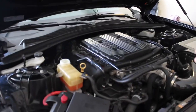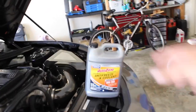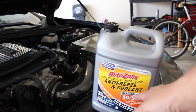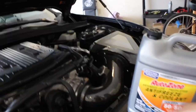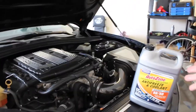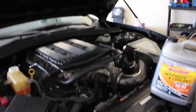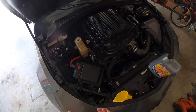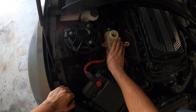I think it's the same for every four-cylinder, six-cylinder, or eight-cylinder — they all use the same coolant system. Obviously the LT4 has more heat exchangers, but for this part everything is the same. You should be able to use Dex Cool 50/50 for GM on every single one. You don't have to use 50/50 but it saves you from having to mix water yourself. I think this was like 15 or 17 bucks, so it's really not that expensive for a gallon. I might need quite a bit of it, so I'm about to put on the head strap and walk through how to do this.